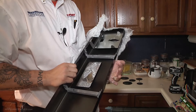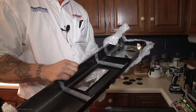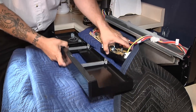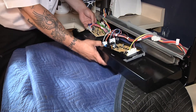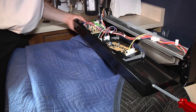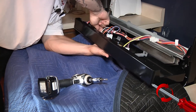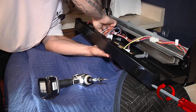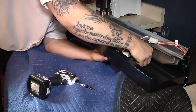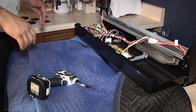Now we're going to go ahead and put in our electronics. I'm going to take my moving blanket and lay it across here so I don't scratch the face of this while I'm doing that. We've got our moving blanket down to protect the face of this panel. We're going to set our electronics in the area in which they go and fasten everything down. I'm not going to tighten that one down all the way so I have a little extra room to wiggle and adjust so the other side can line up. In theory, we should be able to pop this into position and attach the screws to mount it. Our end caps have to go inside the panel, so we'll tuck those in, and then our panel should roll down into position so we can attach those screws.